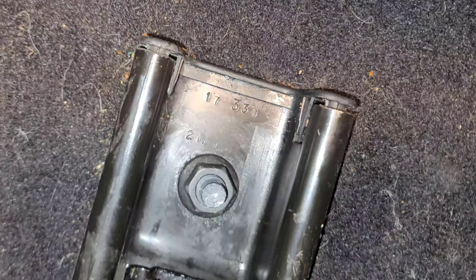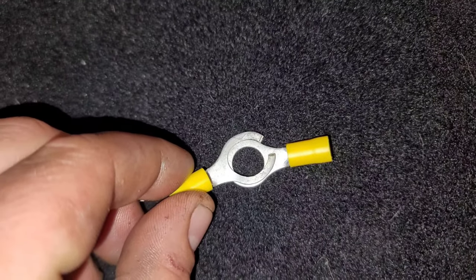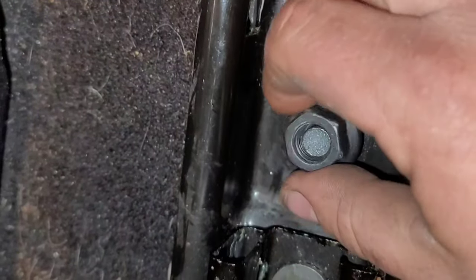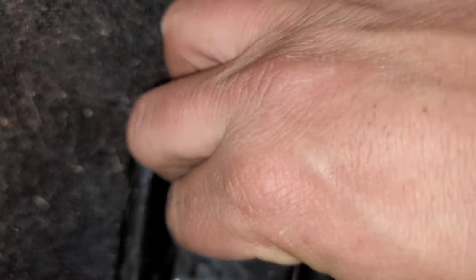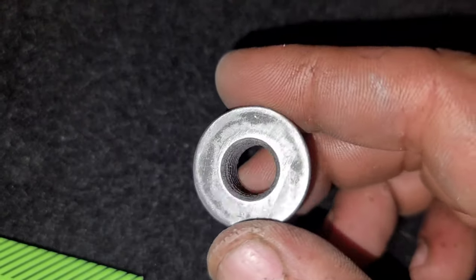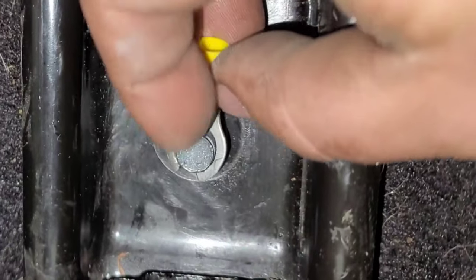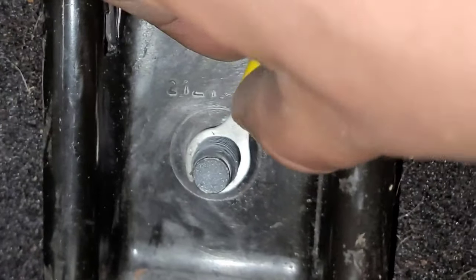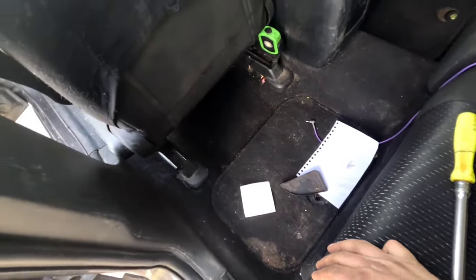For the ground, I'm using the nut from the seat post. To properly access it, I took one of these ring terminals that fit a 10-to-12 gauge wire and split it open so it could fit onto the stud. Remove the nut, scuff up the area, and try to get as much paint off as possible to get the best connection you can. Do the same with the nut itself. With it split like that it was able to make it onto the stud, and I got that running all the way back to where the amp is going.